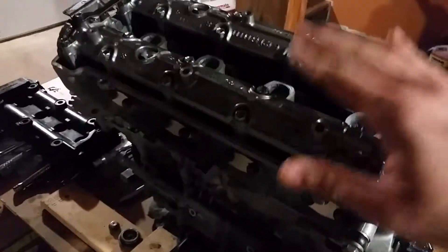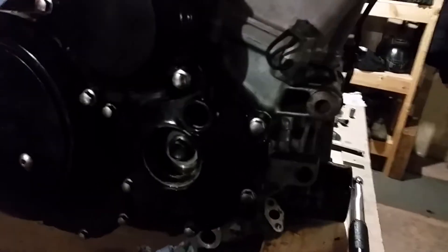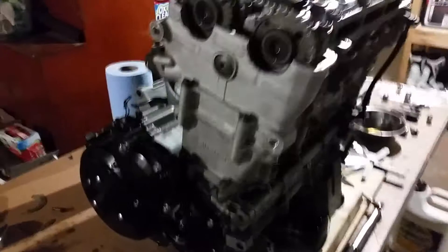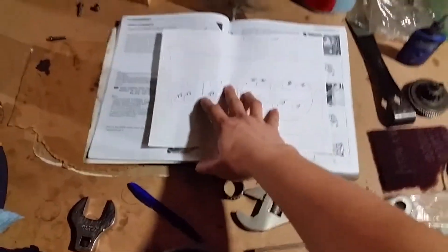This is what you're gonna see when you pull the cover off: your cam holders, cam chain guide, cam chain sprockets. Then your timing marks are gonna be down in here through this window on the Hayabusa — it might be different on whatever bike you're doing, but it's all basically the same idea. You're gonna turn it over to the specified timing marks. The most important thing: you need a manual, either in paper form or downloaded online — get it, you definitely need it.